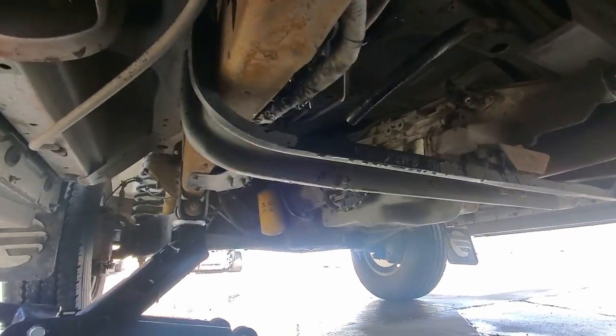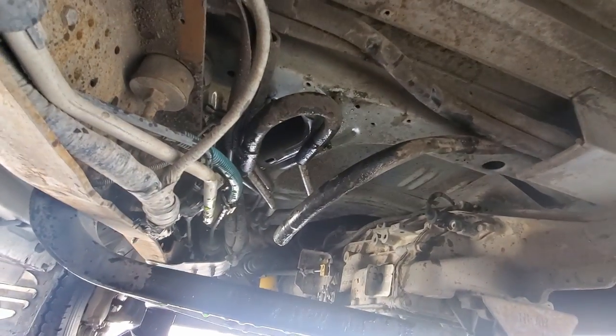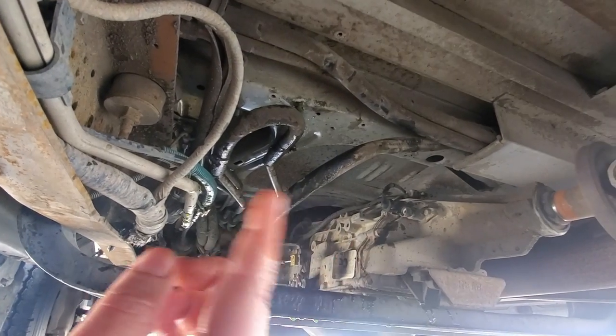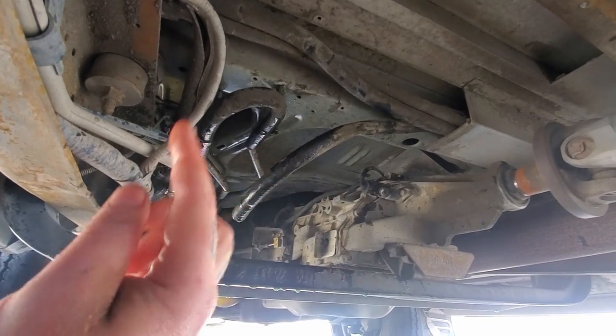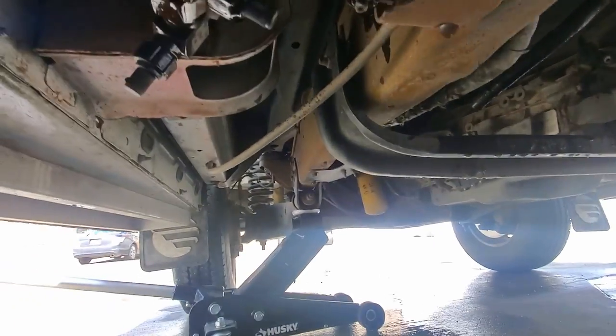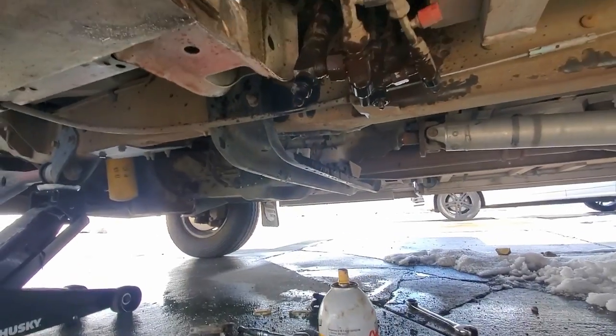As for the coolant lines, all I did was loop them back. So you find which two of the coolant lines, take a piece of the hose that was connecting it to the AC unit and just do a loop and make sure you do the clamps up tight, and you should be good. Okay, so I was right.